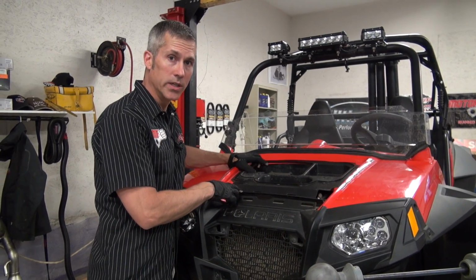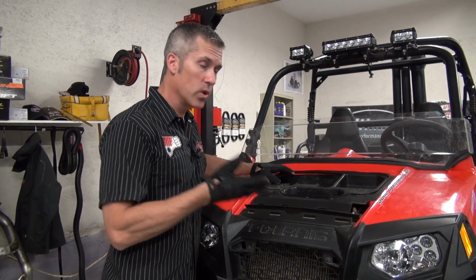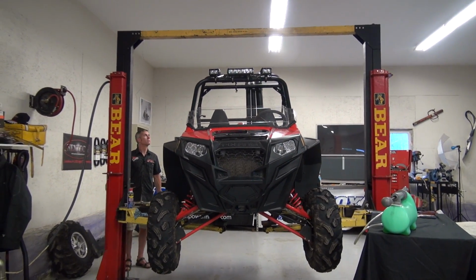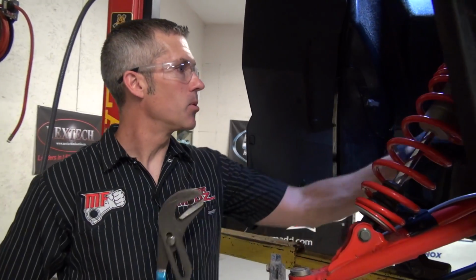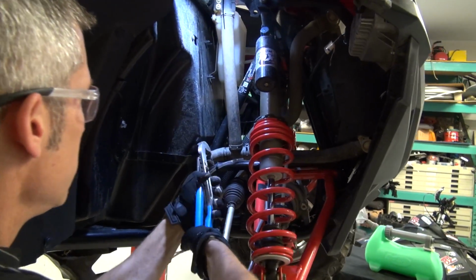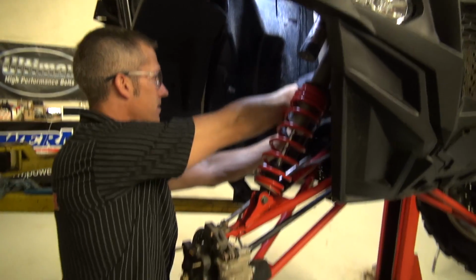We're taking a good look at the cooling system on this machine. Now you don't have to actually lift it up to do the work, but we're going to do it. Helps the cameraman out a little bit. So I've taken the coolant down as low as I could. Everything's out of the radiator. I'm going to the next lowest point here that I can get in this hose. Pull that back. There's going to be some spillage, so be prepared for that. Put a little drain pan down.